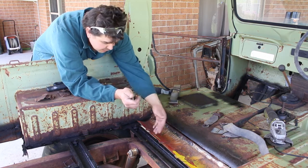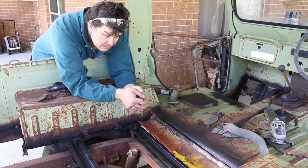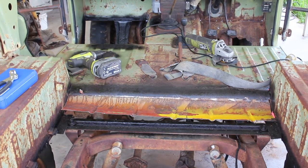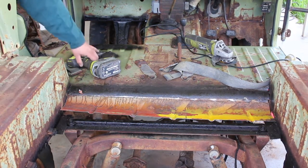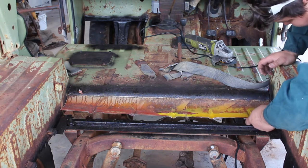I'll be able to pitch off this floor brace and work out how far back I'm going to cut this, and then start welding it in. God, this is going to be horrible. Well, that's one Cleco in — turns out it's actually not that hard to do, just bang a hole through and stuff the Cleco in. Now that's in, we'll try this side. I've already pre-drilled the car body.